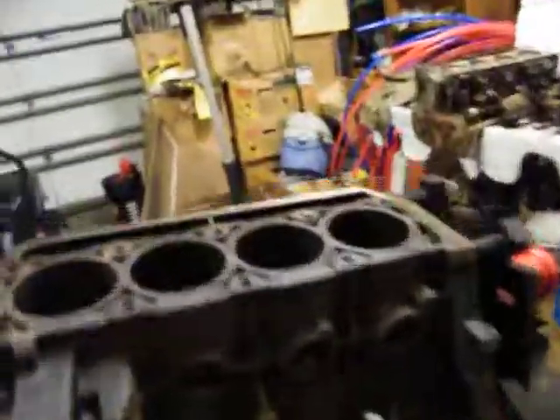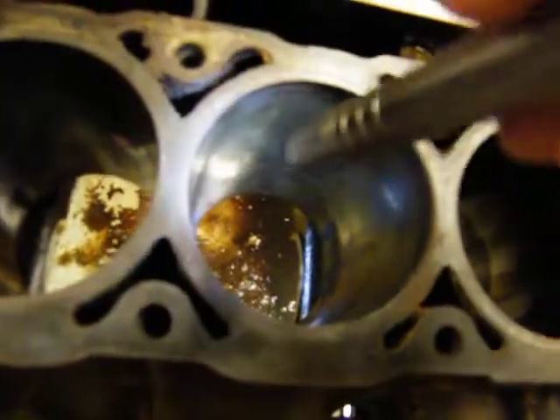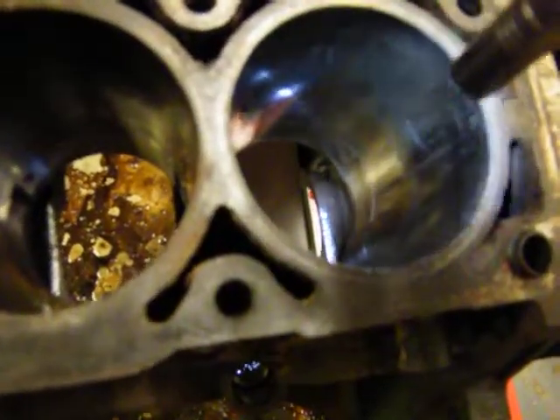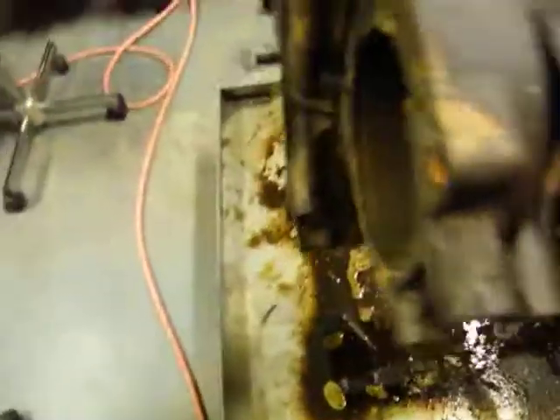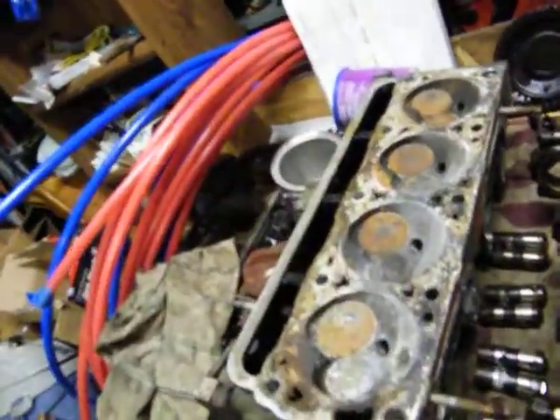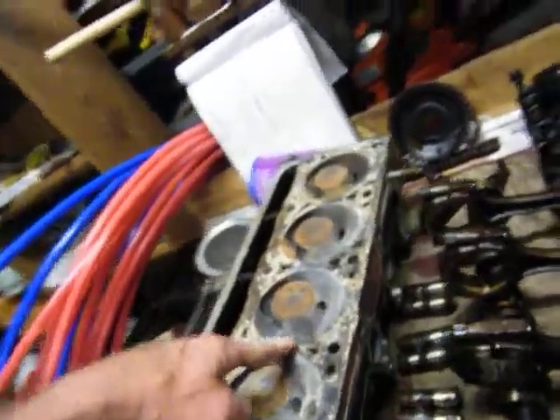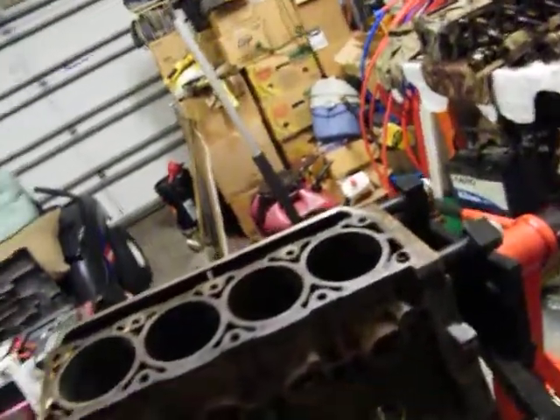Looks like it's just going to have to fix the head. I expected it's pretty good and I don't think the block's cracked. It's just the head and probably the gasket went out on it, but this right here — burnout chip or something, something might have got down in there. What it was doing, this cylinder right here was blowing so much pressure into the water that that's what popped these freeze plugs out.